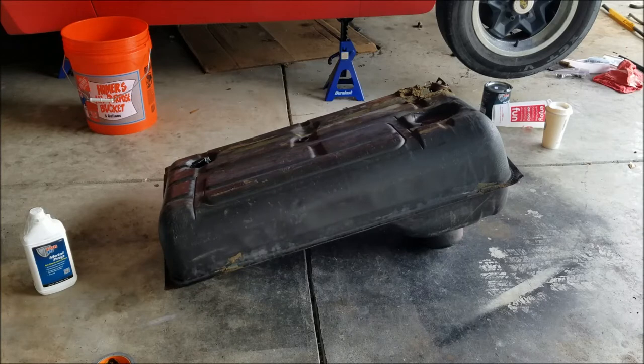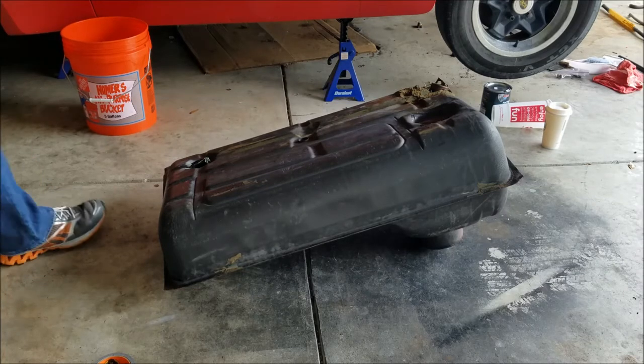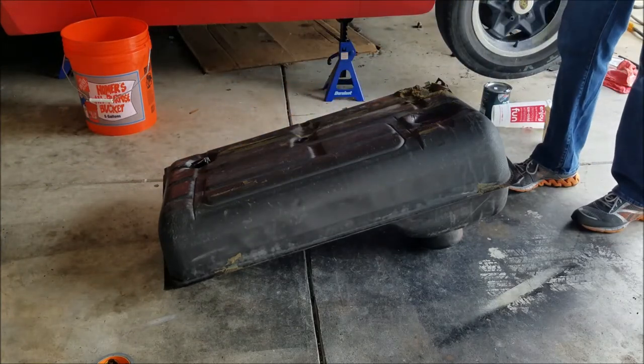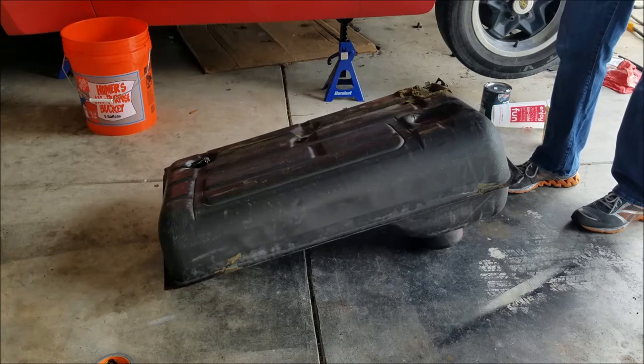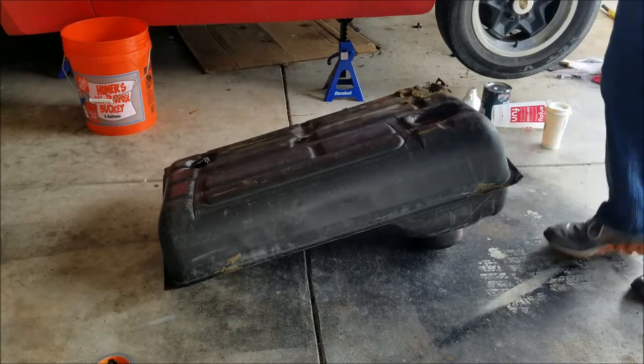And after we rinse it out very thoroughly with water, we have to get this as dry as fast as possible. And the POR directions actually say to get this thing bone dry before we put the metal prep on. So we're going to go ahead. I'll pour the bottle in right now. And just like any of the other bottles, get on here and tape off.